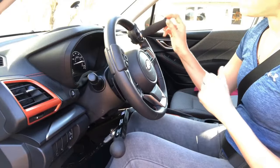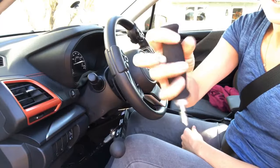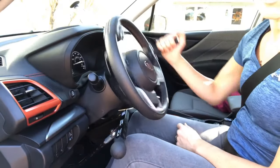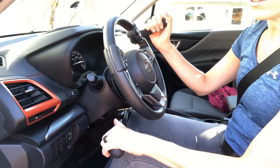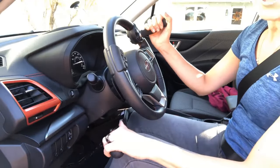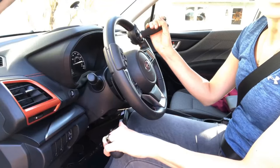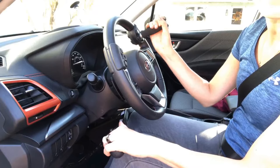I've also added a different spinner knob here. This is a steering device called a single post. It's great if someone's having any kind of trouble with pronation. It slides right into the mount, and again, we can turn the wheel to the right and to the left easily. With this hand control, individuals can still practice coming up to the regular turn signal. Or if they're having any difficulty, we can again incorporate different buttons, Bluetooth mechanisms to help record, and have ability to use secondary controls like the horn, the wipers, the lights, and the turn signals.